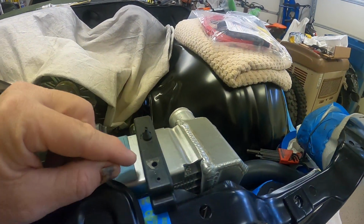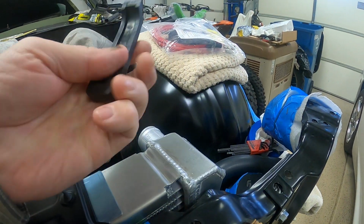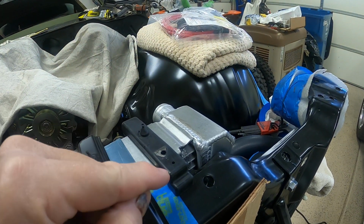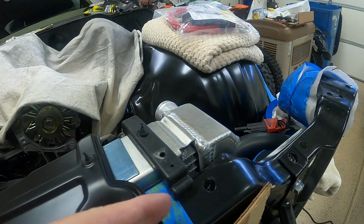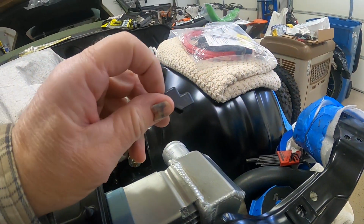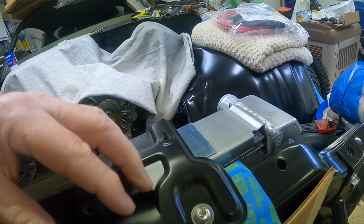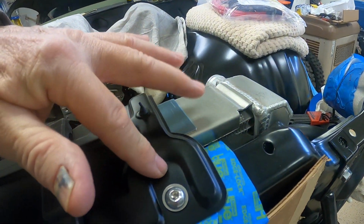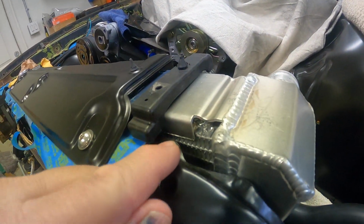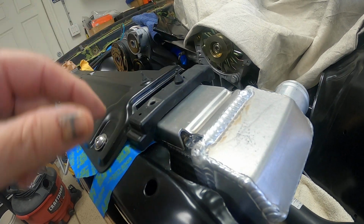And this back portion here has a metal tab that's been over molded in. The rest of it's just all flexible rubber, except for its back part. And this metal piece here steps down and cuts across. So what I did was I cut the back of this off and made this flush going vertical. And that allowed me the room I needed back here on the top cover plate to get this butted up against the core. Anyway, I hope all this is making sense.